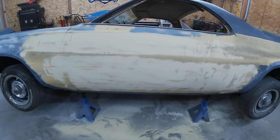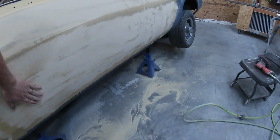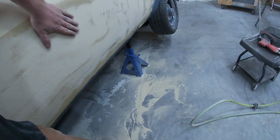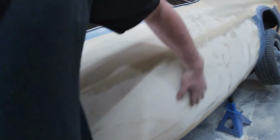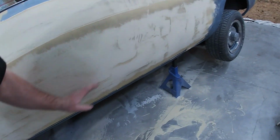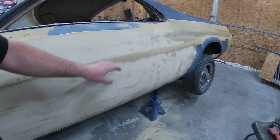All right, I just wanted to take a quick minute to show you guys kind of what I'm looking at. So I'm sanding pretty flat with that sander, as flat as I can. And when I sand, I'm running it back and forth at an angle and down at this curve also. And then I'm coming back and I'm X-ing it. When you X them and you're sanding scratch directions like that, it's pretty well impossible to get her crooked. Everything is gonna straighten up pretty good that way.